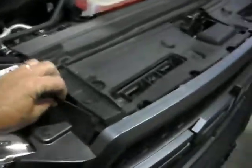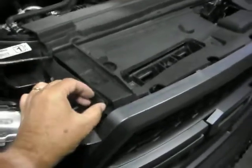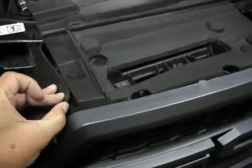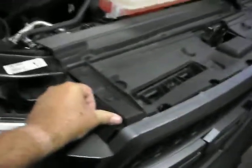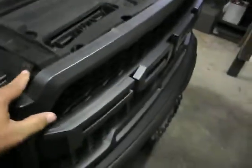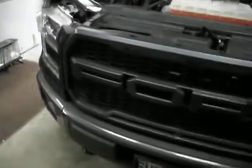That whole inside of that grill is just a big piece of plastic with a little electric motor on it. Now these rubber little boots on each side of the grill — the plugs on those don't have the piece that you gotta pull up, they just pop out, they're just standard plastic plugs. I think there's three of those that you gotta pop loose to get the grill out, but they don't have that inside piece — just the main ones on top. I just thought I'd save you guys, if you're gonna change it out, from having to buy some plugs.